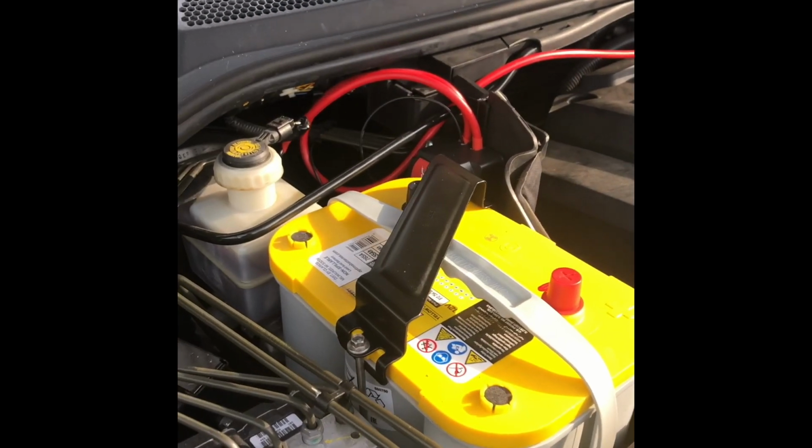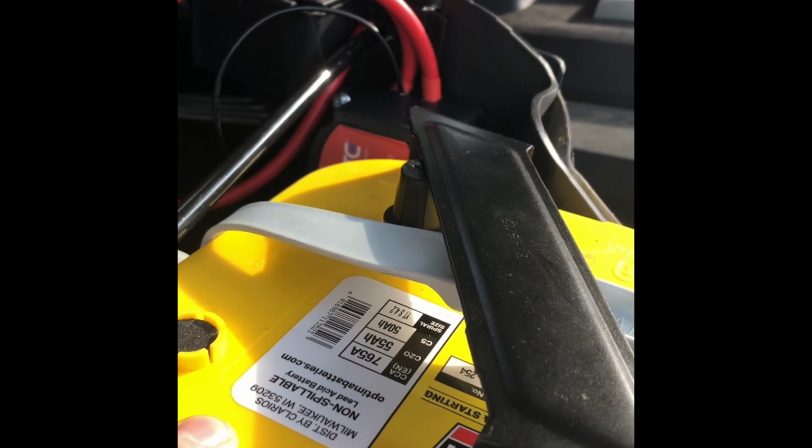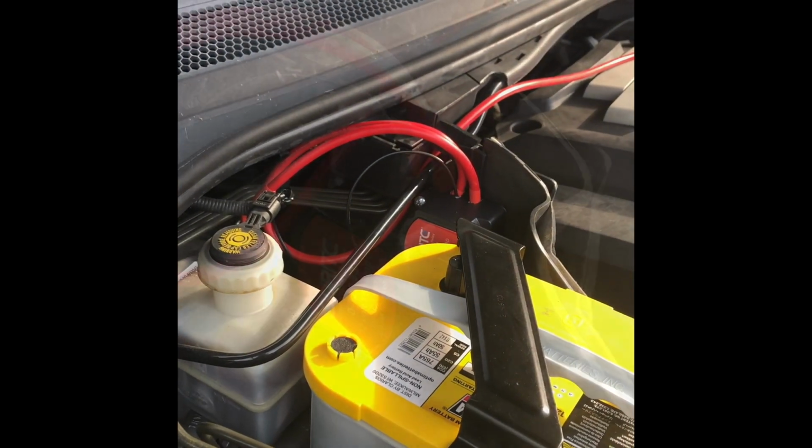Hello again. So if you're joining me, it's day 2. You can see I've actually had a shave. What I'll show you now is why I wanted to mount the battery the way I wanted to mount it. See, I have second guessed myself today and switched it round whilst I was drilling for the relay, but I'll show you what the problem is with that. As you can see, the negative terminal is now, or would be, touching on the battery clamp, and that's obviously not a good thing. So the original plan will stick. I'm just going to have to slightly adjust what my second guess wiring was going to be.